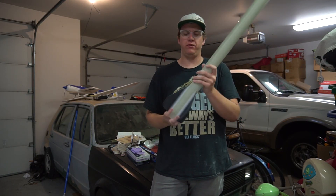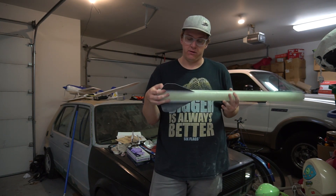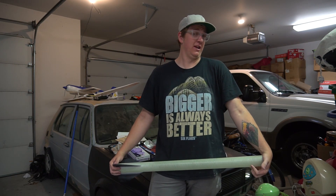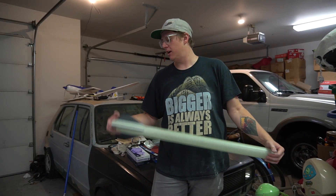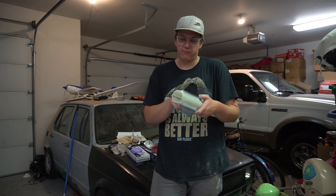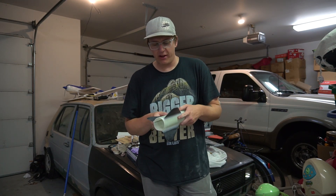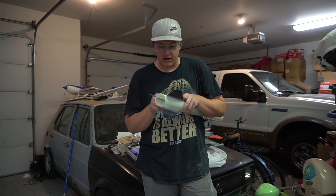Recovery mode initiated. I didn't do very well documenting this, but I pulled it all off. We did new fillets - they're dried, I've sanded them to shape, beveled everything up really nicely. My record forum post from Tony Alcoser - I think that's how you pronounce it - he was concerned about the presence of small bubbles in the epoxy. I think a lot of the appearance of bubbles is the filler itself, but I do think there is a good amount of bubbles in West Systems Epoxy. They are very microscopic, and these are on there pretty good, so only time is going to tell how that works out.